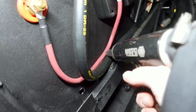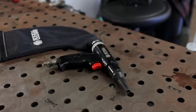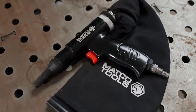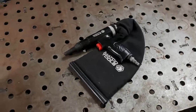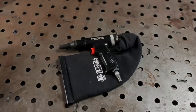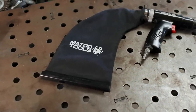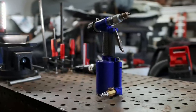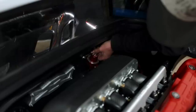This gives me an opportunity to show off a new tool: an air-powered shop vac. It may not look like it, but it uses an air compressor via the venturi effect to create suction and fill the bag on the back. It comes with all sorts of nozzles and extensions for reaching tight places, and you don't need an extension cord. Several people at SEMA told me their favorite part of these episodes are the tool suggestions, so I'm linking a cheap version in the description. On the topic of tools — I got out the air rivnut gun from a previous episode and added rivnuts to the rear firewall for the fuel pressure regulator mount, though I forgot to hit record while doing it.